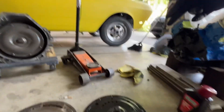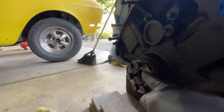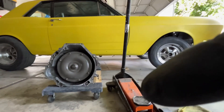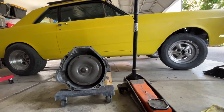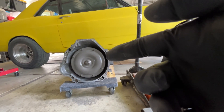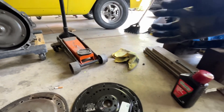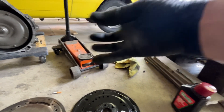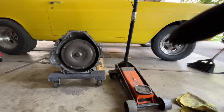After I bolt that flywheel up, I use the torque ring and torque it to 80 foot-pounds. I set the block in and my back spacing is not there — I need an eighth to three-sixteenths of pullout, so the torque converter pulls out to the flywheel when bolted together. That way, when the engine is spinning, it pushes slightly onto the torque converter without damaging the front pump.